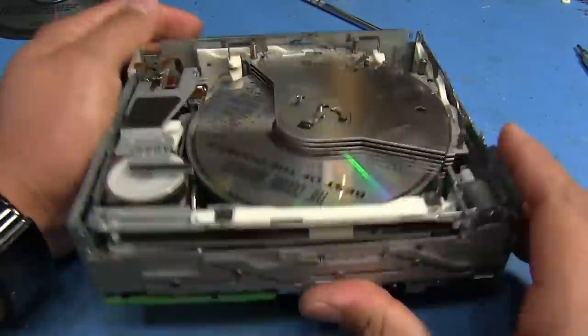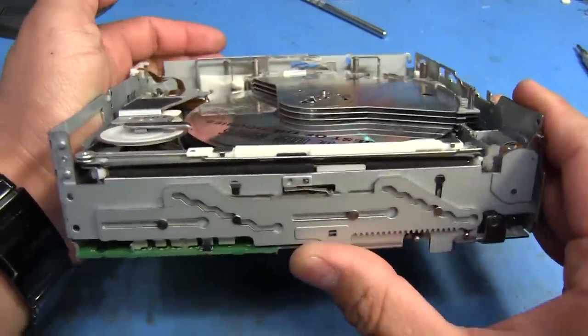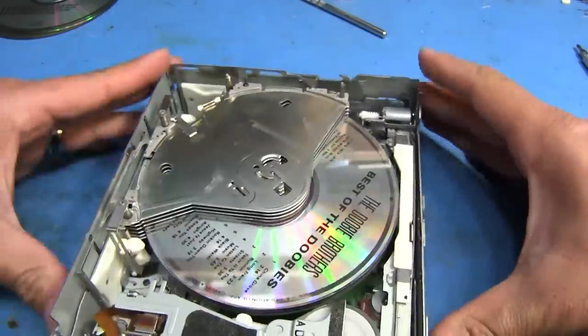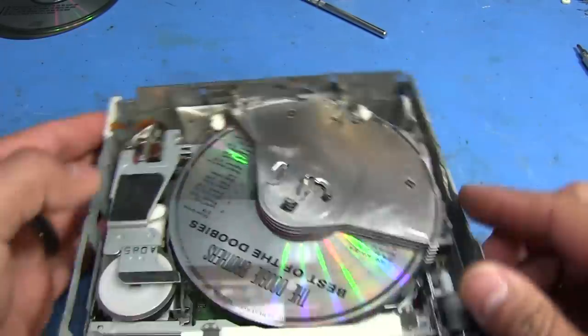I'm going to rotate the gear inside there to get it to where all these trays come together. I should be able to get them to all come together at some point. Yeah, this thing went really out of alignment. There we are — and now it gets to a point where this gear gets really easy to rotate. It gets to a spot where there's hardly any force needed at all to get it to move, but if you go a little bit past that point it'll get a little harder. So I'm going to leave it there — now this thing should be able to move side to side fairly easily.